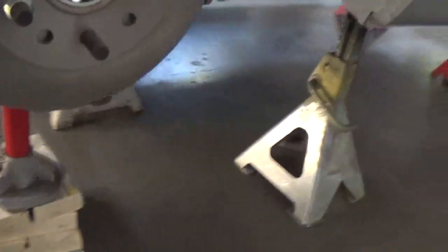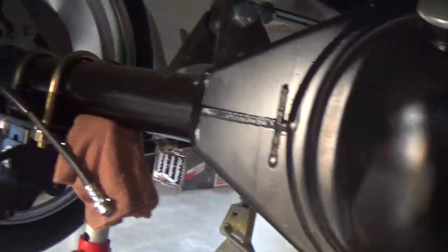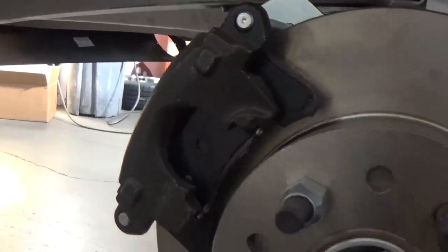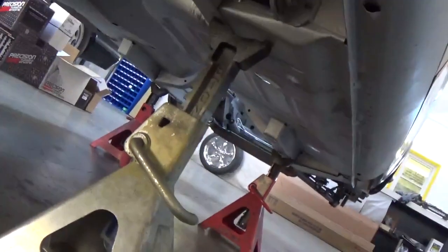We've got a simple suspension system with a new 9-inch. This is a strange 9-inch rear, and it's a canted 4-bar system. So you'll see the uppers aren't there yet, but it's getting preliminary fabbed in place. The lowers are, there's your lower. It's a basic, simple suspension, simple brake system, which I would like to see this gentleman upgrade the brakes, but is it needed? Not necessarily. It's a good little package. And this goes into the original frame. Solid.